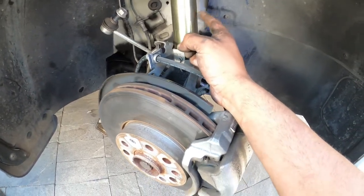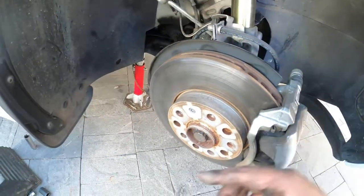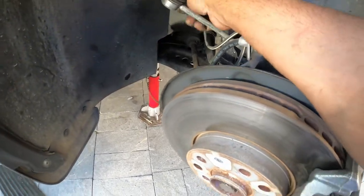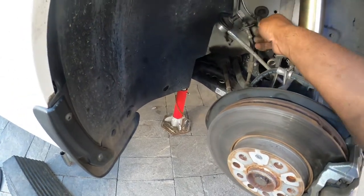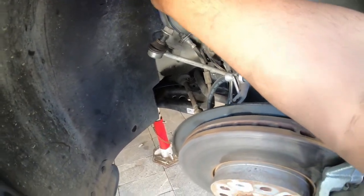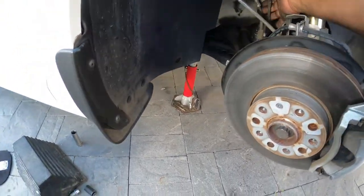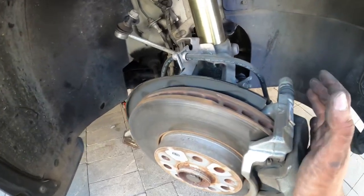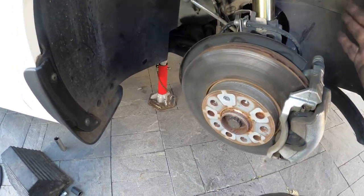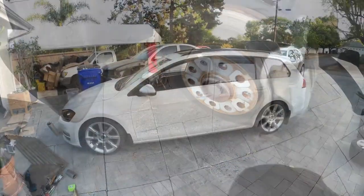You're also going to need to remove the tie rod. When you unbolt everything and take it apart, the brake line and brake sensor are going to be extremely tight, so be careful not to over-extend them — you can cause some fun damage, possibly a new brake line. I almost did, so just giving you a heads up. Ball joints unbolted, everything else as shown previously — the next step is to remove the axle bolt. That's extremely important during this process.